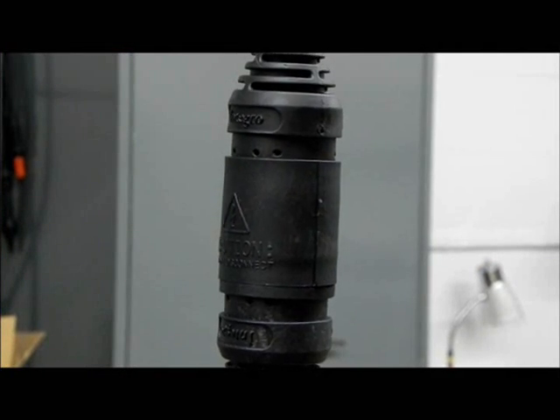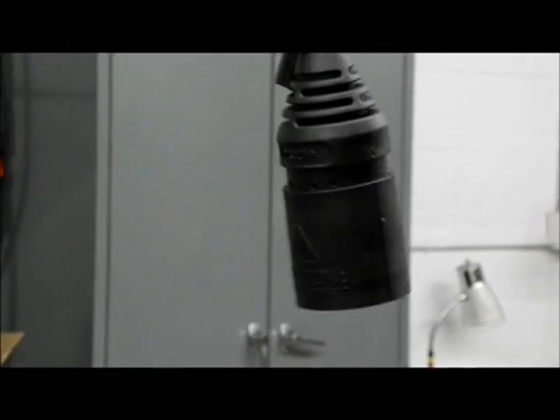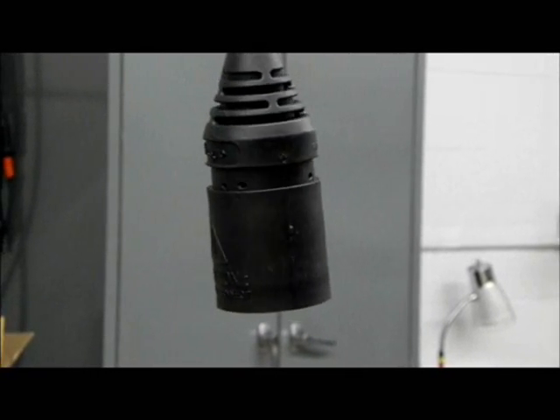Adding an inline breakaway will first properly break the connection by utilizing the pilot pin loop to de-energize the cable. And if strain is excessive enough to potentially damage the station, the breakaway will separate, leaving the terminated side up out of reach. The remaining cable will be de-energized and protected from inadvertent contact by following SAE safe touch standards.